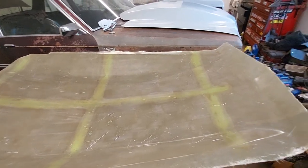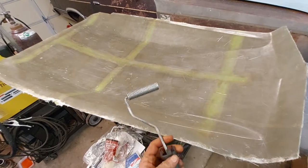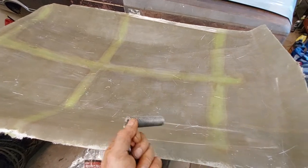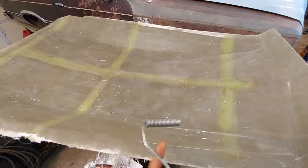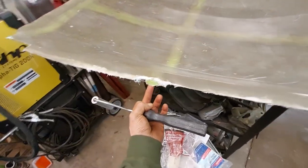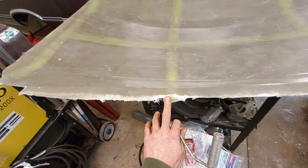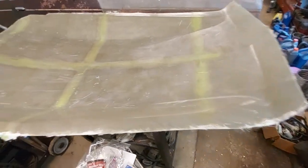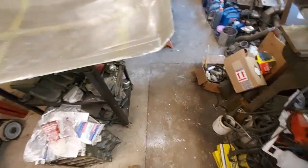I made this roller that my wife uses — it just goes in there and gets all the air pockets out, keeps everything tight. I usually get pool noodles from the dollar store for about 10 to 15 cents a piece this time of year, and I add those on and glass them in just for some reinforcement to hold the mold to its shape.